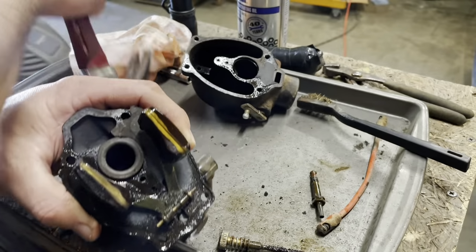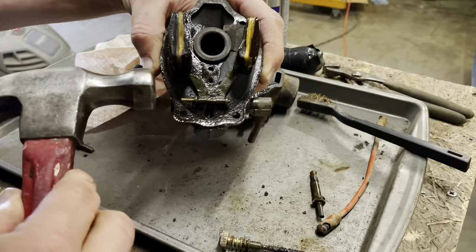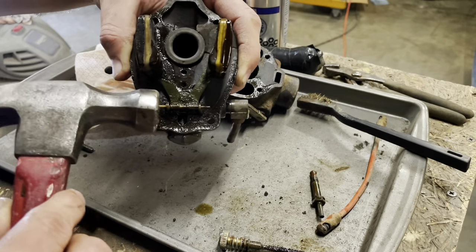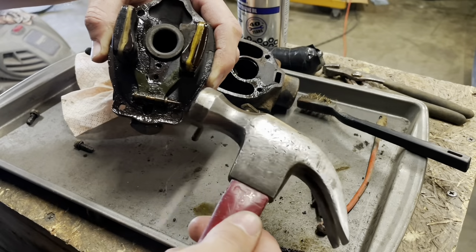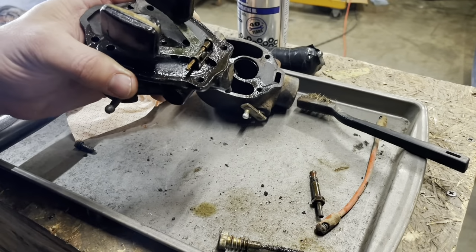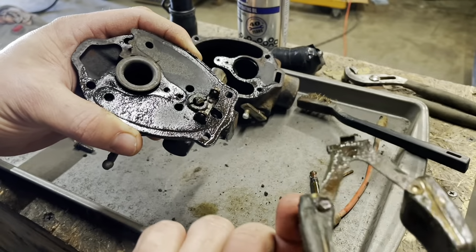Okay. Do a little tappy tap on her again. It can stick in the tabs that the thing swings on and on the float itself. All right, now she's moving freely both directions. I'm just barely wrapping it. See if we can get a hold of it. You don't want to grab it way up high there, just right on the end. Extracted.